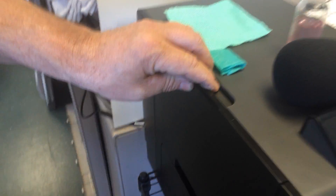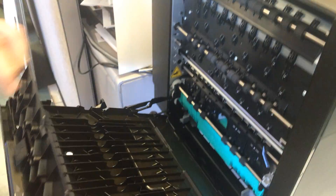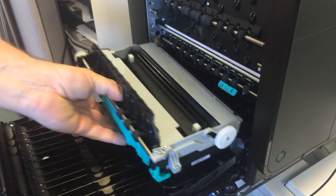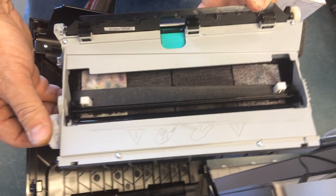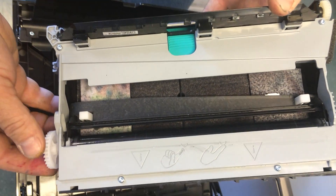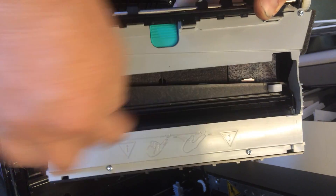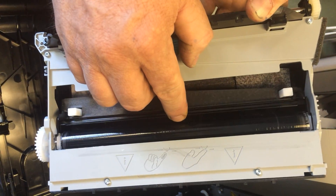To do this process, we'll come over here. The waste ink tray and the printhead are both accessible from the left side panel of the printer. You'll take the waste ink tray out — this one's actually fairly clean, it's got some ink film on the roller bar, but not much buildup.